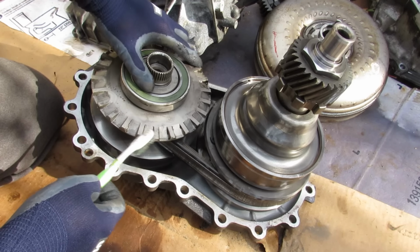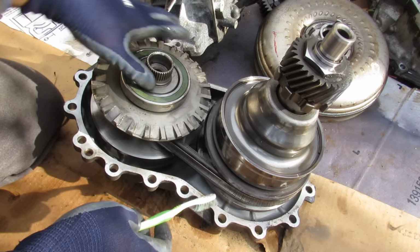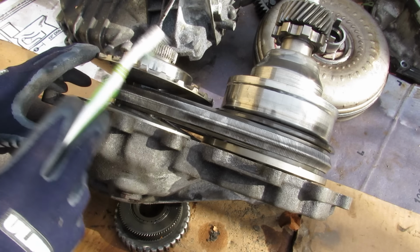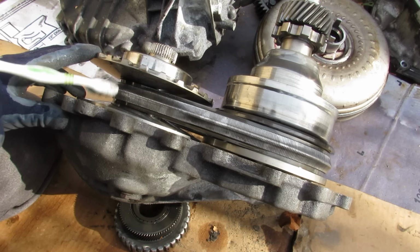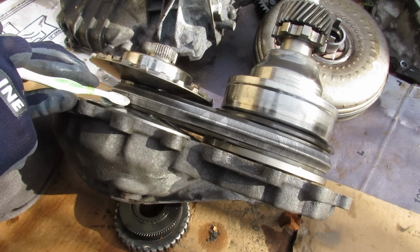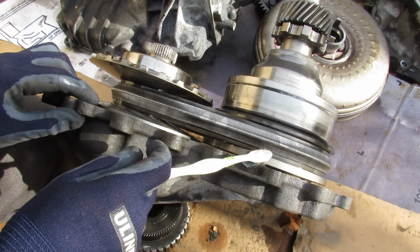Now connecting the two pulleys is this steel belt, which has to be flexible enough to go around these pulleys, yet strong enough to transfer the torque. Now taking a look from the side, the way this continuously variable transmission is going to vary its input to output ratio is by changing the effective diameter of the pulleys from the input to the output. So for example, in this case, the pulley is adjusted so that the belt has the smallest diameter on its input over here and the largest diameter on the output.